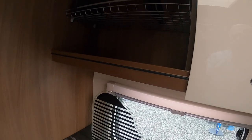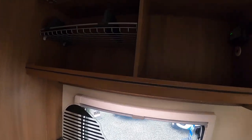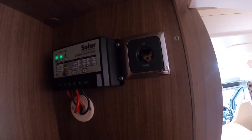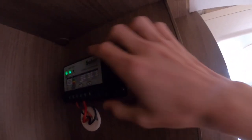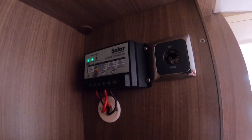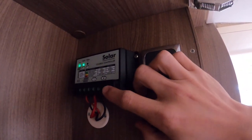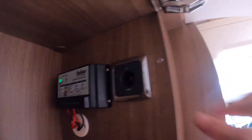Above you, if you just push the handles down to lift the cupboards — in this one you've got a rack, and in this one you've got your solar panel regulator and a 12 volt socket. It's showing green flashing which means the battery is full — that's your leisure battery. There is a terminal here to get it ran to either a second battery or the engine battery in the future. Then you've got a 12 volt socket.